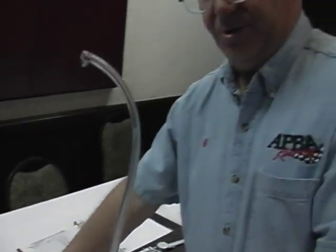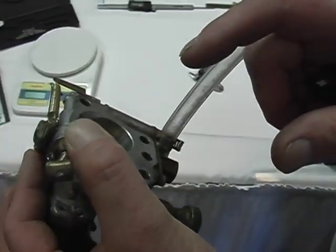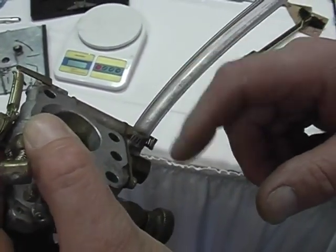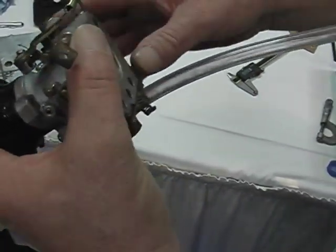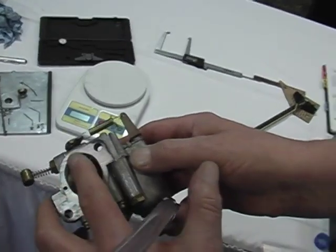The other thing we do is look at the carburetor. At this point in time, we start going inside the motor. Visual is very important. You have to look at it and determine, it's called as cast. You're looking for machine marks. If you look in this one, all you're going to see are the factory machine marks or the as cast marks.